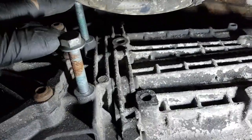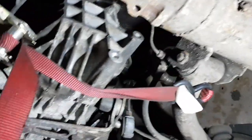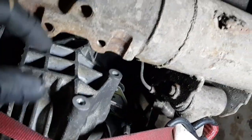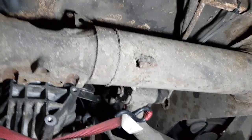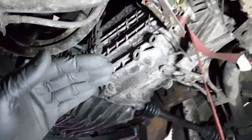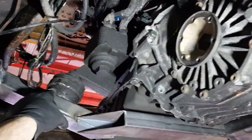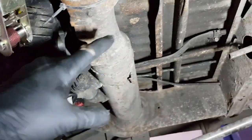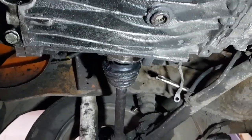On this side we've got two bolts and two threads on the gearbox. Because we're running so much power, I'm thinking we could utilise those small holes - there are four of them, threaded. I can make a bracket going down from here, put a bush there, use those two holes, and maybe another bracket here with a bush to stop the gearbox going up and down. When you accelerate it goes up, and when you decelerate it goes down. The gearbox mounts are very soft, so there'll be a lot of movement, and this bush could give it a hand to control that.